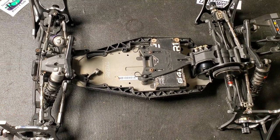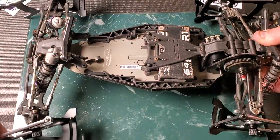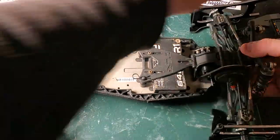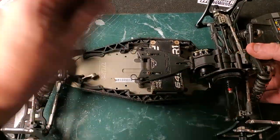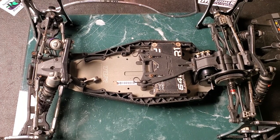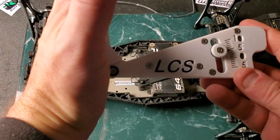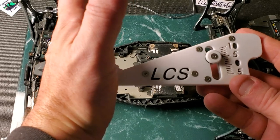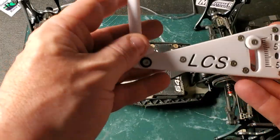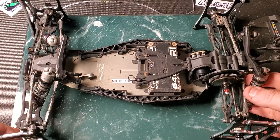So there we are with it installed on the car. Now, how to use these. What I find is the stands are a little bit more precise than gauges. I do tend to use gauges when I'm on trackside on race day just for quick adjustments — I'll show you an example here of a gauge. These are the typical type that you put your tire up against and it'll tell you how much camber or caster you have. I'll use that for rough adjustment on race day, but as I'm building I'll assemble it and put it on the stands.